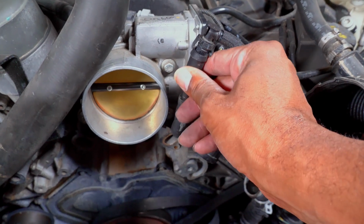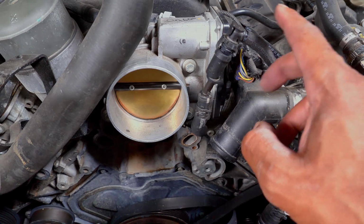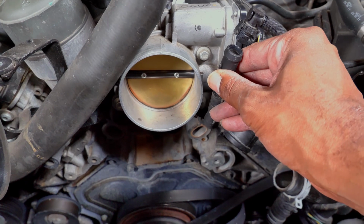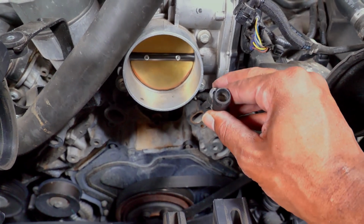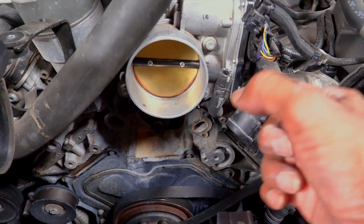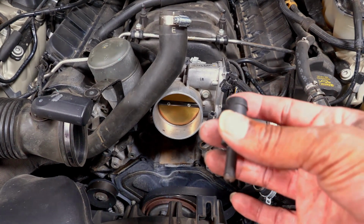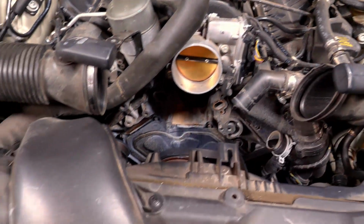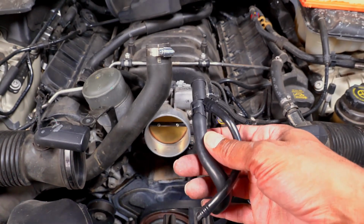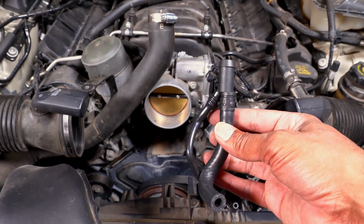So what you can do is take off the tube that comes from the overflow. If you take that out, then as you're pulling your water pump out, it can lean, and maybe you can loosen this clamp, pull it out, and then once you have the water pump in your hand, you can pull this out. Maybe. So if not, then you're gonna have to go buy one of these, and like I said, I'm gonna leave the link in the description, so if you need it, you will know just how to get it.